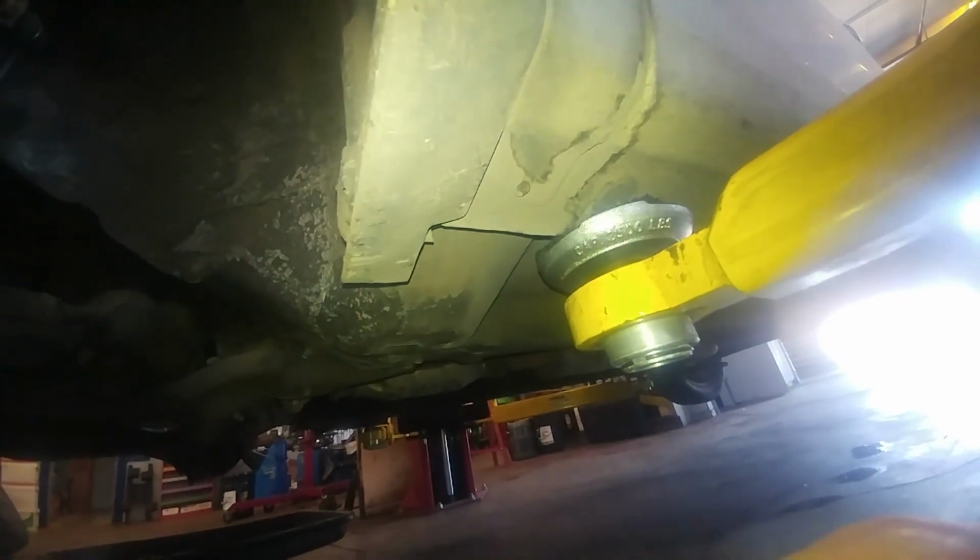Some metal in here. Certainly jack up. I'll just go on the edge here. See what's underneath here. Oh, if you want to, right in the middle, you can jack up so you get both wheels off the ground. And then I would just, if you're gonna do that, go ahead and do that. Use safety stands, protect yourself, break the lug nuts loose on both sides, and then jack it up after they've broken loose a turn or two, and take the wheel off.